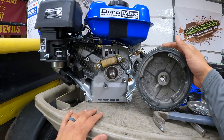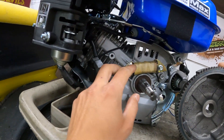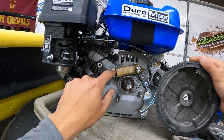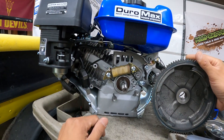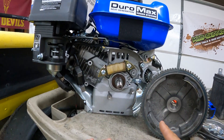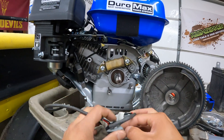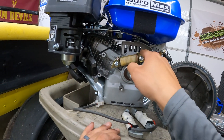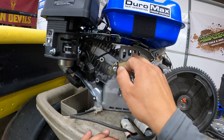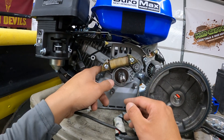These are the stock components: the stock coil has only one wire coming out, and the strand of that wire is very tiny, showing how small the coil winding probably is. That wire goes to chassis ground and one wire goes to the output diode in the control box. The new coils we're putting in are isolated from chassis ground, so when the magnet goes through the cycle — positive, negative — it gives us a charge on one end and then the other.